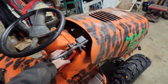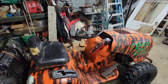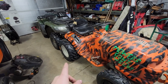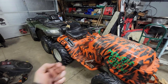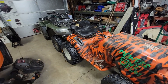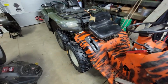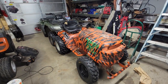I was able to keep everything all nice in the box, put it all back in there with all the wiring, and been able to keep it as clean as possible. She's more or less ready to push button and go. I still need to get the hood finished and mounted. I did go with nicer, bigger bearings in the back, and the original sleeves that go from the bearing to the hub help keep everything solid when you castle nut it down. I got them off so I need to cut them to size and get them back on before I start running it. I've got a little more play in the tire than I'd like.